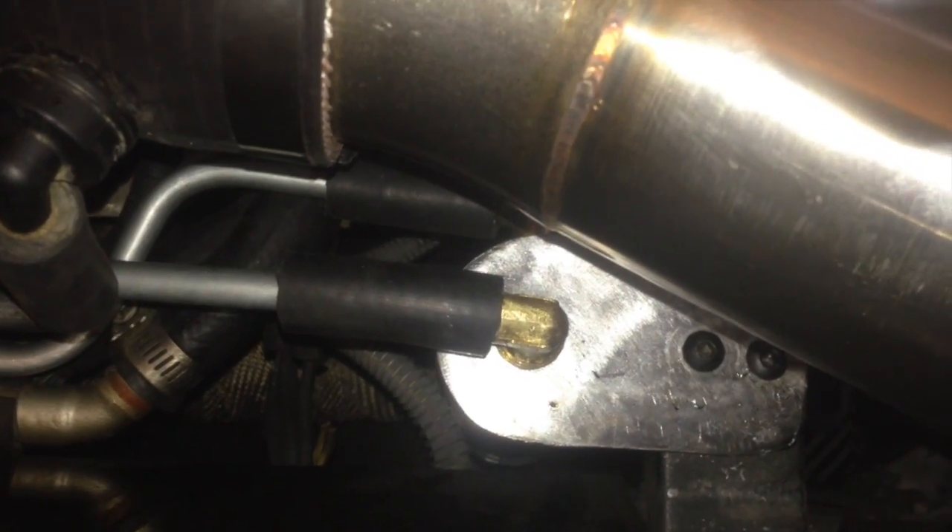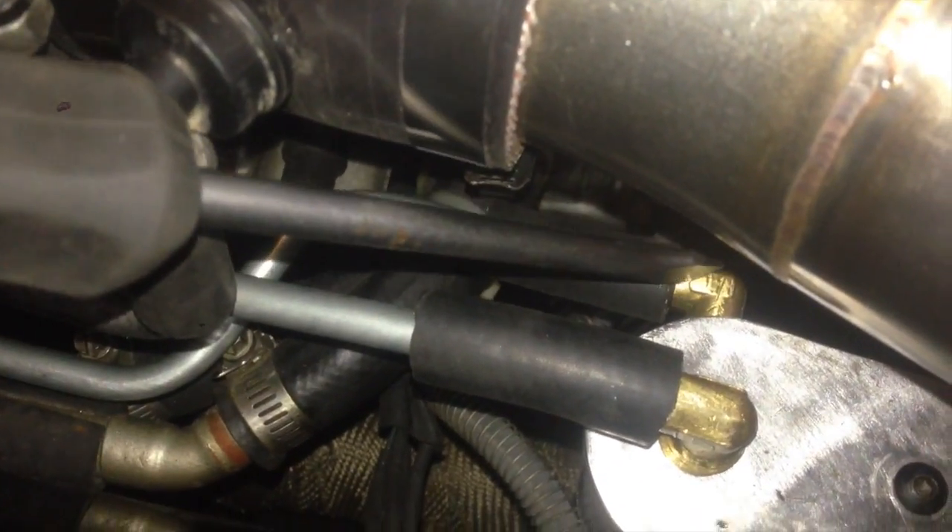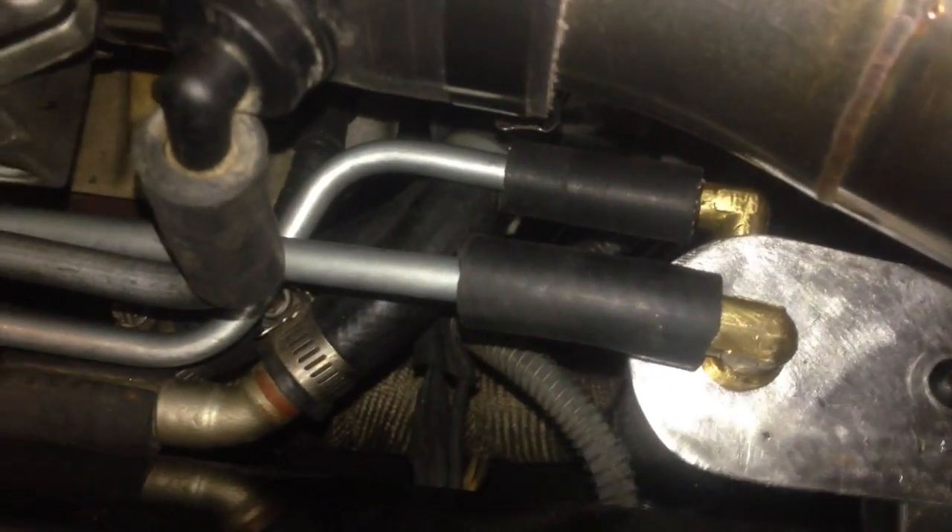It goes to the center of the top and it should drain down into the steel wool. The outlet from the catch can is vacuum — it should be clean air coming back towards the intake manifold. This should provide clean air for the engine instead of oily air.